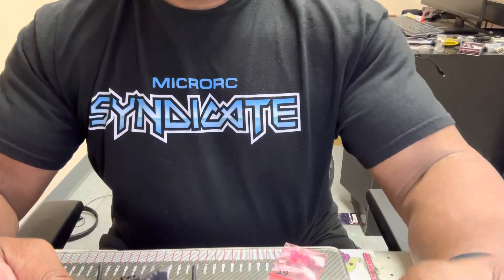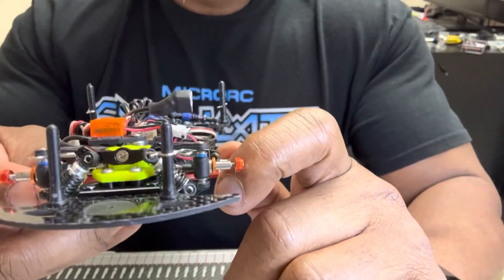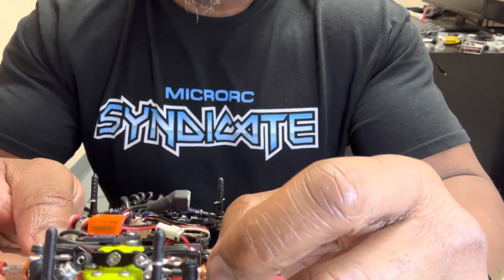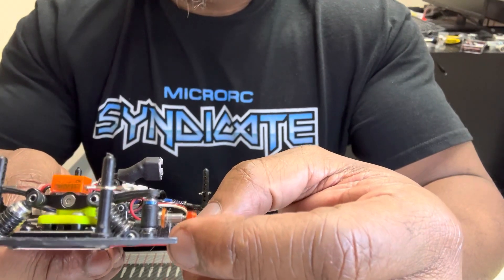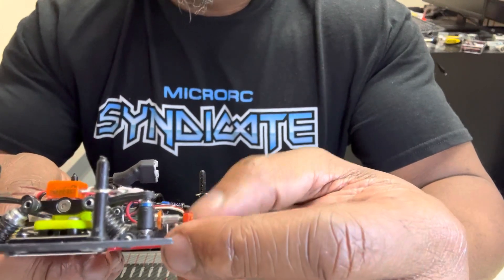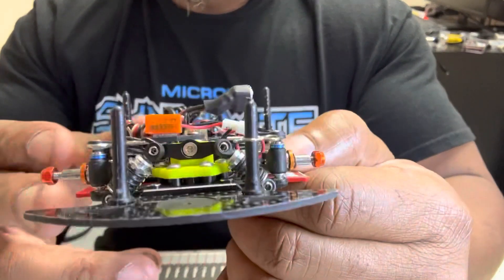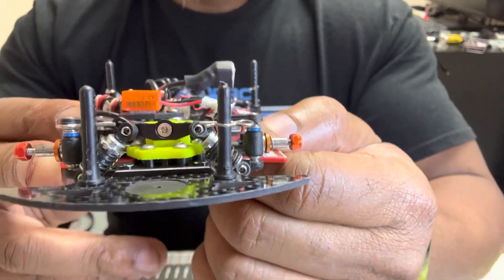Next up, the Julia front shocks. These things are money — full aluminum, very well built, very good close tolerances. I can't stress enough that you need to have these shocks on your GT. During testing, over a two-day period we greased them once Saturday morning and once Sunday morning, and the car actually got faster throughout the day. The old GT's worst problem was the shocks were inconsistent and you had to chase it all the time — these, not so much.